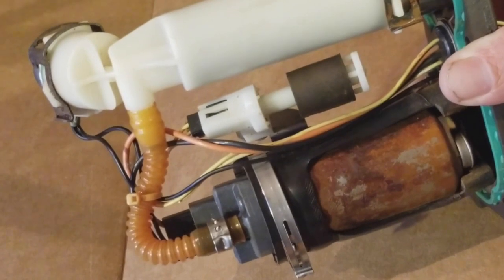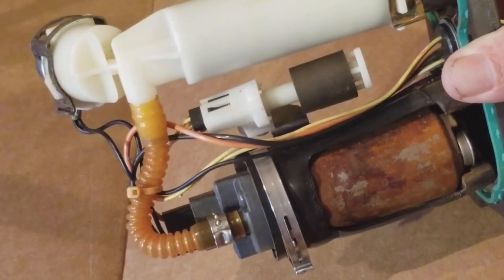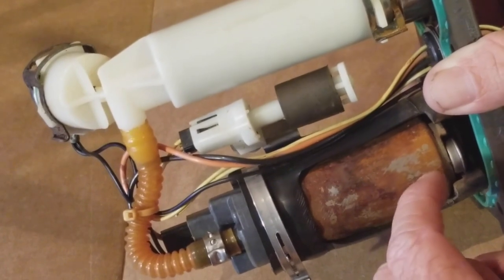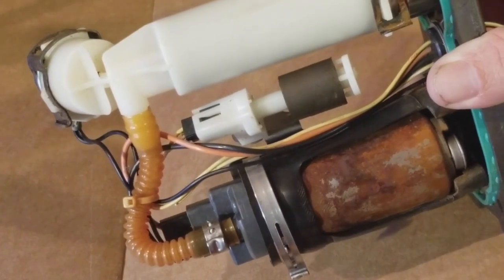So what I'm thinking happened is the sock just gooed up, as well as maybe old gas and just whatever the tank, if you sometimes can get rust from condensation that happens naturally in the tank, and went in and clogged up my pump. That's all that I can think, with hopes that when I do replace it, it's going to start right up.